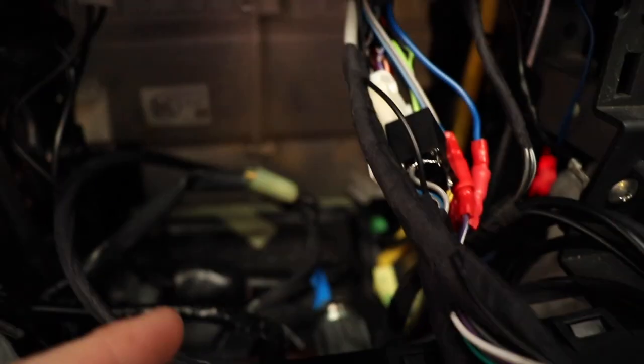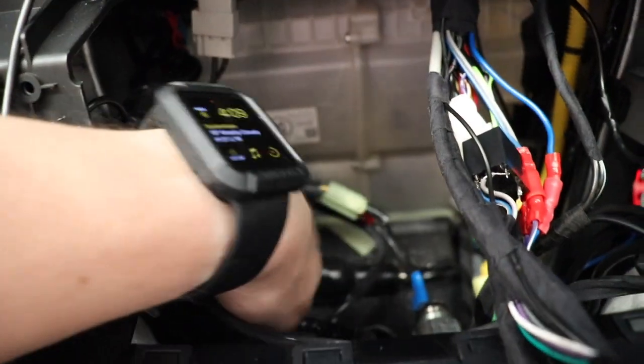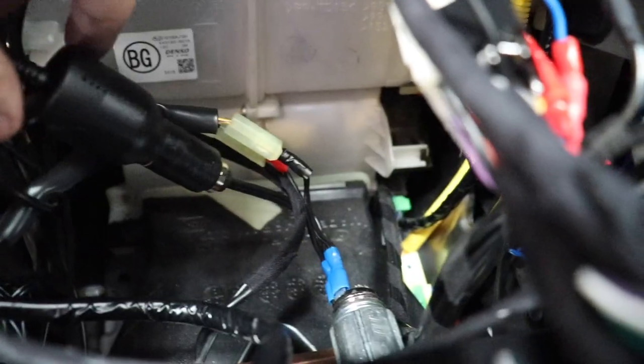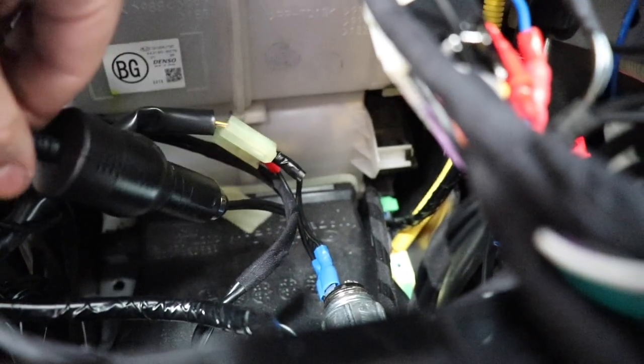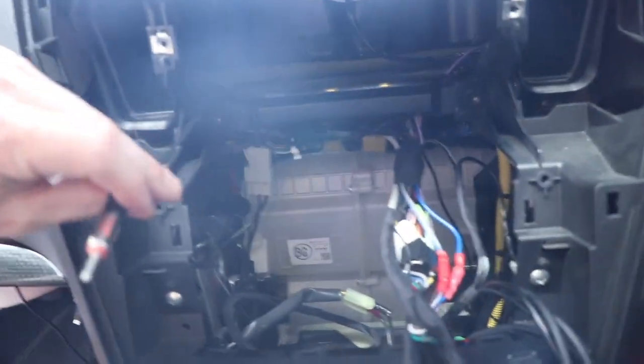I fixed up the cigarette lighter thing. This dash cam here just came with a big long cigarette lighter plug, which I have had hardwired in here for some time, but I just used a female cigarette socket. So what I've done now, I'm not sure if you can see down there, that's it there, but now there's just wires coming straight out of the front of the cigarette socket as opposed to having a plug, and then basically it interrupts the cigarette lighter. These are the cigarette lighter wires. Boom, boom. So it runs off the cigarette lighter. So yeah, I've been doing a lot of wire tidying.